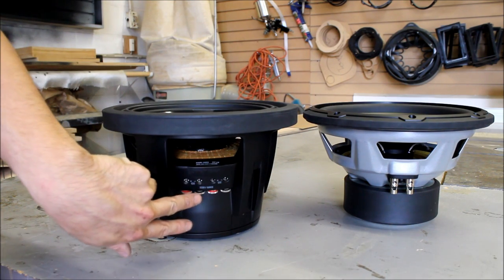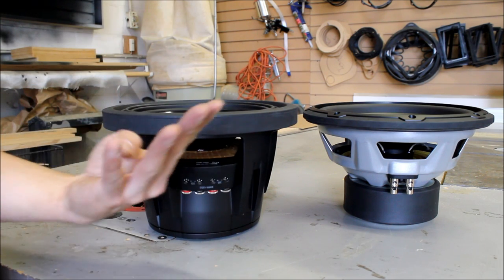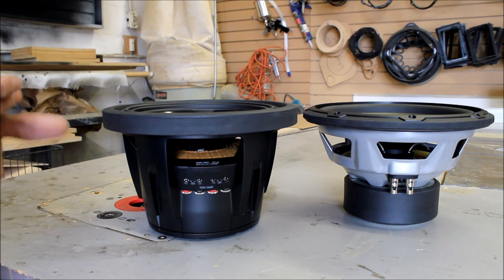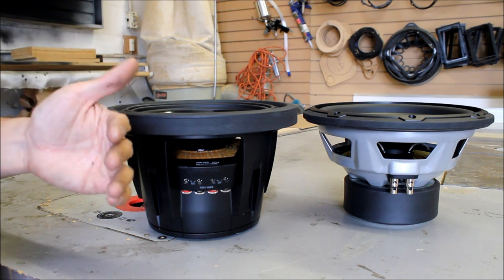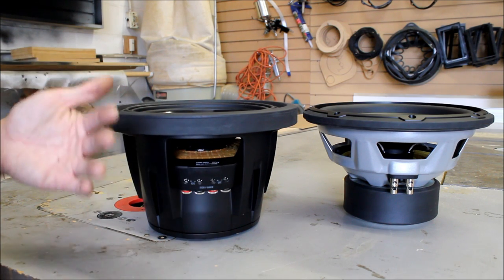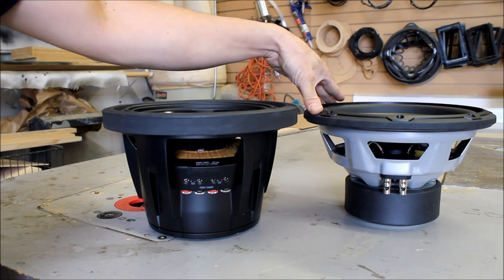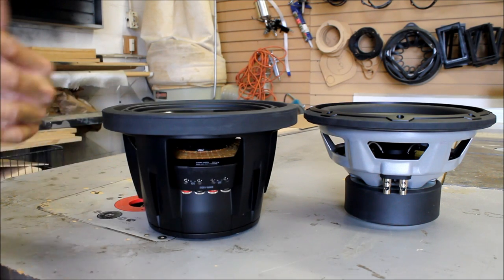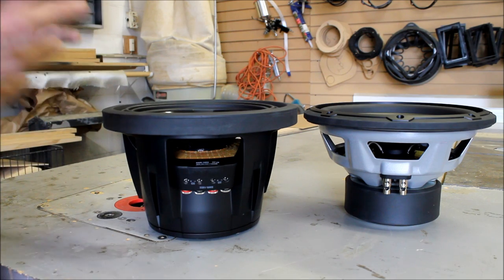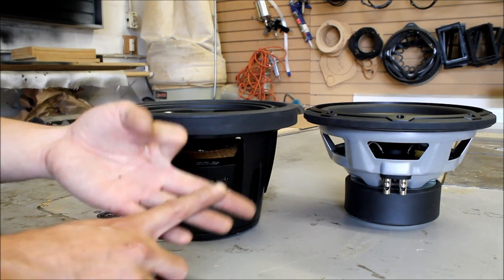This one can be either 4 or 1 ohm because it's dual 2. In this application I'd recommend a dual 4-ohm woofer. This will allow us to step down to a 2-ohm load, because most monoblocks nowadays give you two power ratings — maximum power at 2 ohms, or at 4 ohms you get half the power. If you have a 1,000-watt monoblock, a single 4-ohm coil might do okay since you only need half the power to run the W3. Talk to your installer or a trusted sales rep to figure out the right match for volume, power, and load on that amplifier.